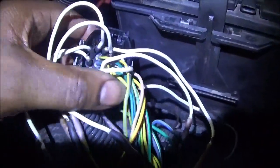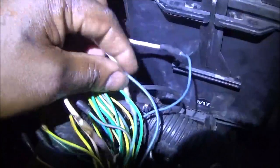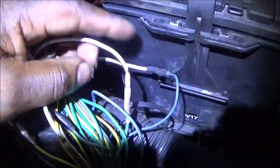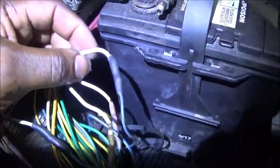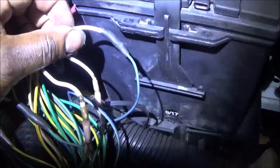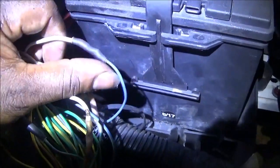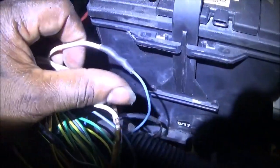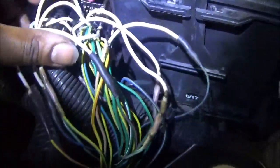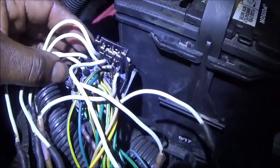I've still got more to go — there are 23 of these things to do. But I'm going to make sure I don't have to worry about this. Some of them I used butt connectors with the shrink that has glue inside, and some I soldered. The ones I soldered were the skinny wires because I didn't want them wiggling around inside the butt connector — I've had that happen before where after crimping it still had a bad connection. So I soldered the small one to a big one.